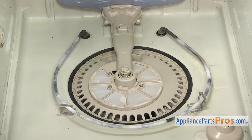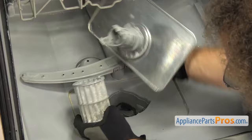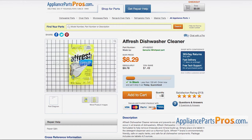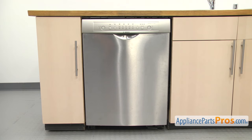It's important to inspect and clean your dishwasher's filter as well. A clogged filter will prevent the water from cycling through the dishwasher properly and can prevent the dishes from getting clean. Make sure to clean off any residue on the interior walls and gaskets. Also make sure to use a cleaner such as Finish or Glisten on a regular basis to help keep everything clean. Keeping everything clean will allow the water to flow properly and clean the dishes better. It will also reduce stress on the motors and pumps since they won't have to work as hard.